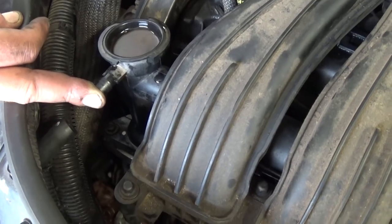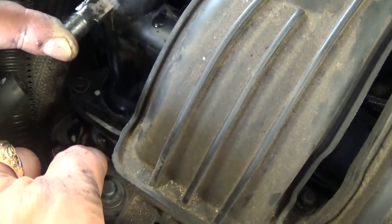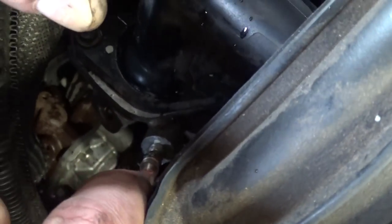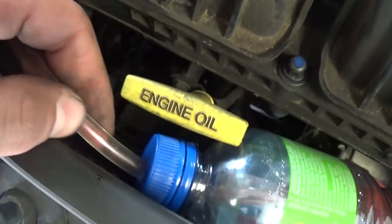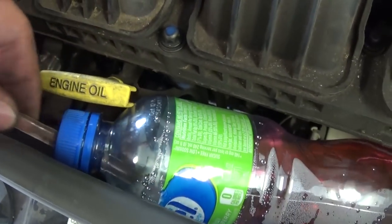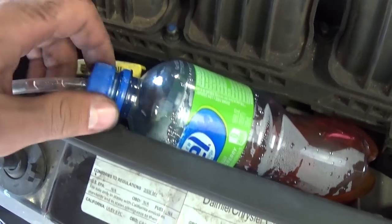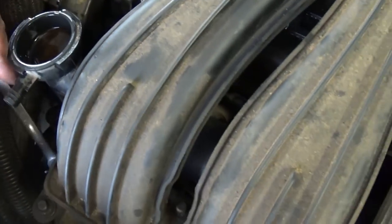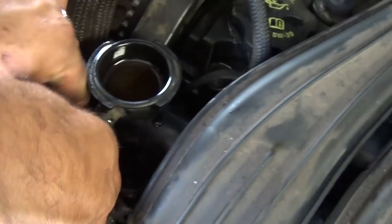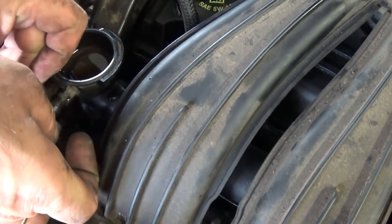Okay, we already did ours, and the next thing is just to get the bleeder tight. You can actually pull the hose out so that we will not make a mess. Let me just do this one right here. And now you just lift it up and we can turn the bleeder and get it tight. Okay, now we need to tighten it with the wrench. It's very limited space there, so even if you have a shorter 10 millimeter wrench, it will be really convenient to use.